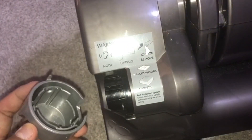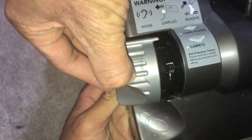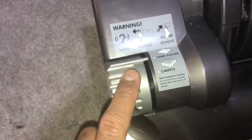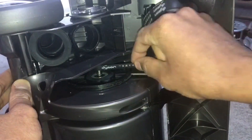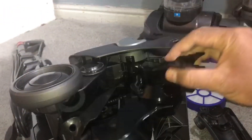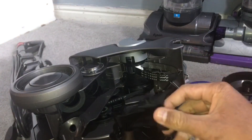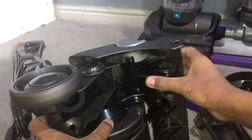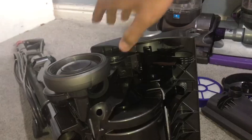Get your slides on so that it mates up with this — you'll see a little clip there. Remember the clutch has to sit in properly for it to go on. Do not switch it on — leave it on the hard floor setting. Hook this belt onto the motor spindle and give it a few turns so it's on properly. Keep checking that the clutch is in properly by just pushing it in. Now put on the clutch cover — line the belt up in here first, and then it goes in nice and neatly. Put the three screws in — there are two here and then that awkward long one. Turn the belt and make sure it's not trapped.